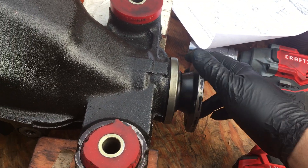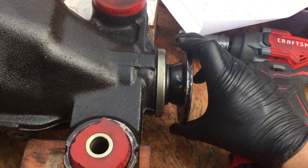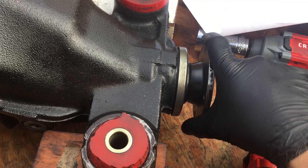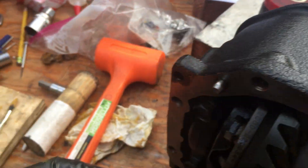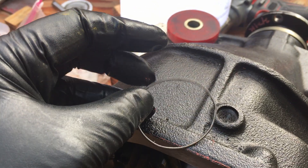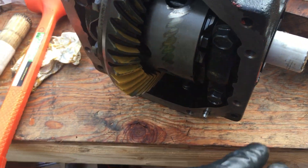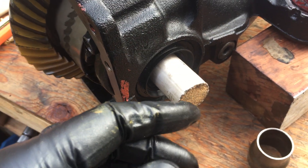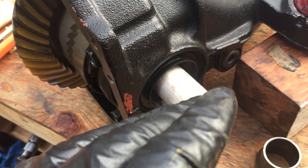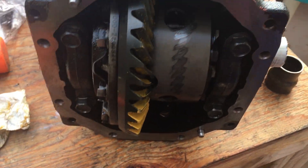This input flange had some wear and tear on it. Next, when I'm done, I'm going to stand it up on its end with some ATF in it and see if it leaks at all. It has a pretty heavy gouge, so hopefully the spring and seal accommodate it. This spring, which I took out of one of these, is inside and holds the little lip in. When doing a teardown, inspect the inside of that lip — gently push it toward you and look at it. You'll see a couple of lines every few segments and they should look very uniform. If there's any scratching on there, just get a new seal.